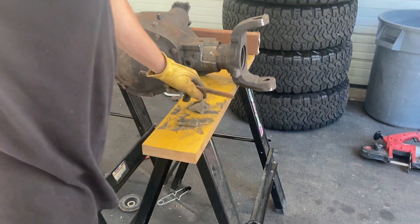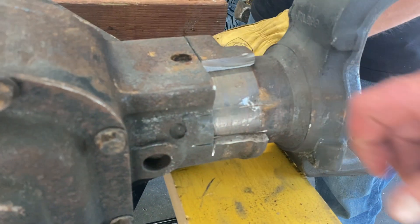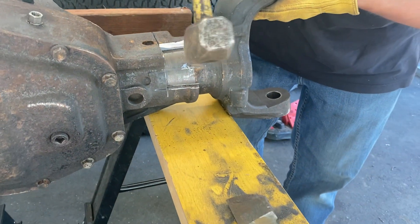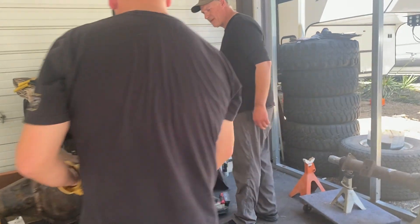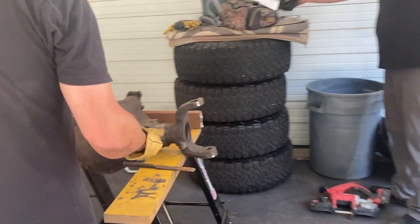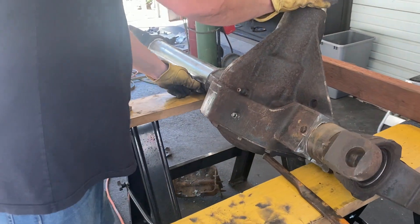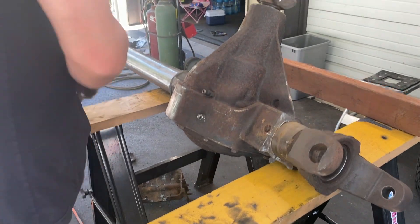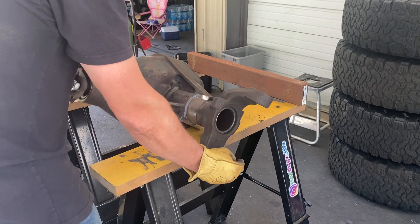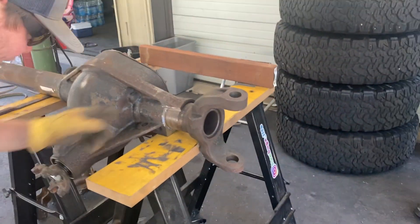Oh, freaking awesome Josh — some scarring, very little, not even a millimeter. You've got some wedges — there you go, pulled the axle out. Looks great — worked out perfect. Then you pull the wedge out and it stays. That's it — that's a portaband result right there.